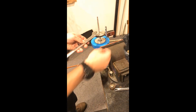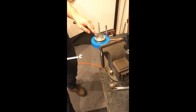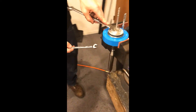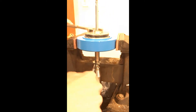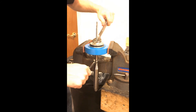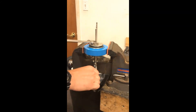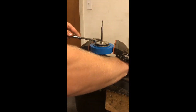We're going to go through this — it's a 24mm. And then you're going to get to the wrench point at the bottom, which is 13mm on the lower piston. So we're going to loosen this from the top disc. Once we get these off, we're going to inspect to see if the piston is bent.